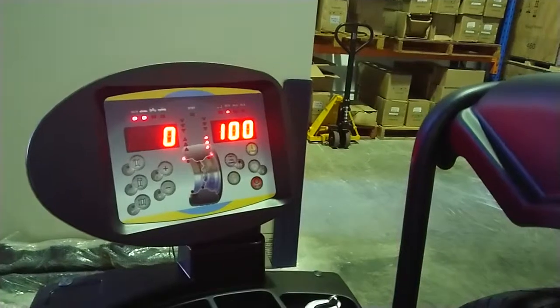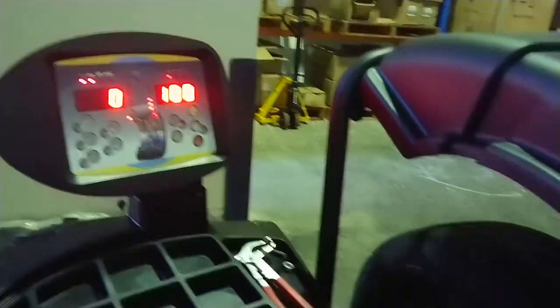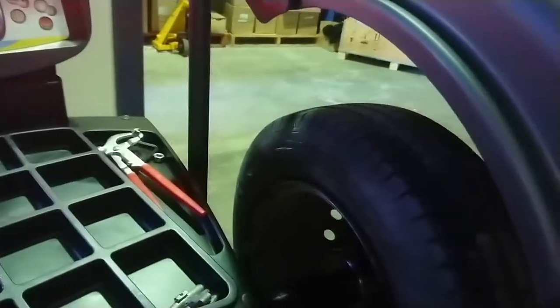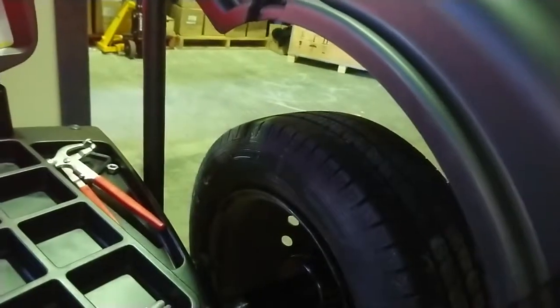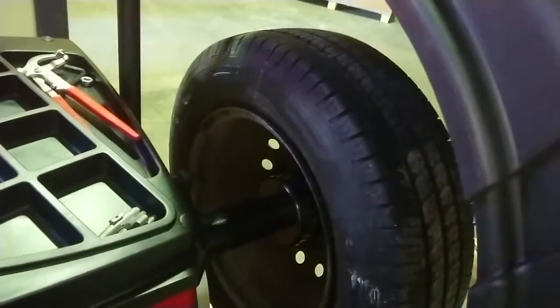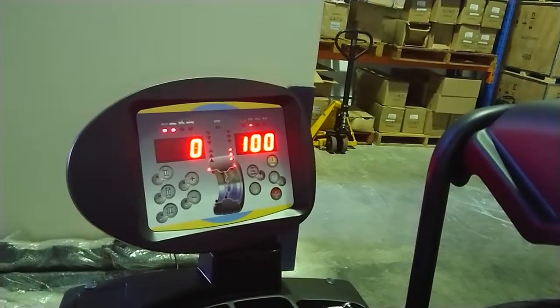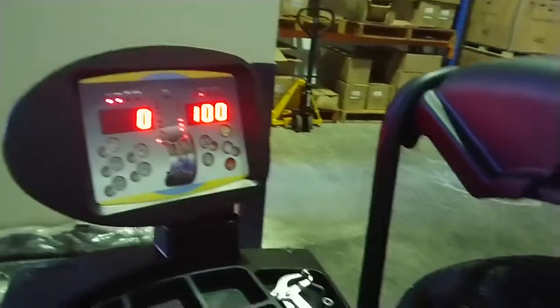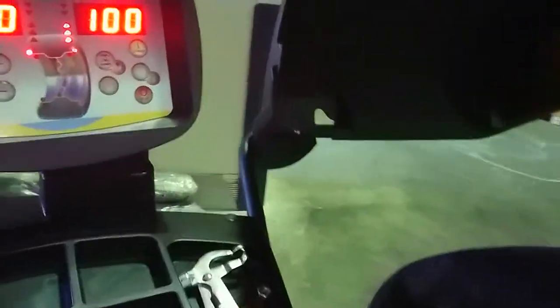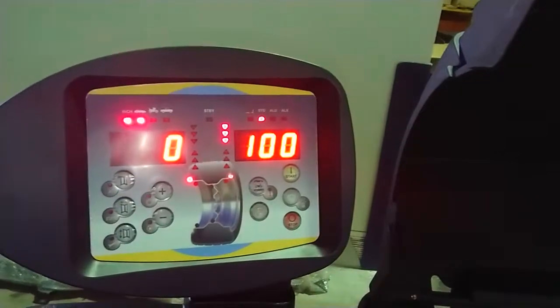As you can see, the light shines on the inside of the rim and it requires 100 grams on the outside. I'm not going to bother knocking it on - this tire has actually got a massive puncture in the sidewall. I only found out when I mounted it that it was completely flat. But there you go, that's as easy as that - just turn the tire following the arrows and the beeps.